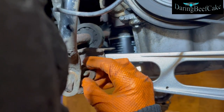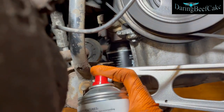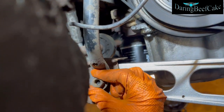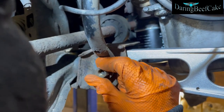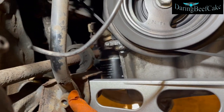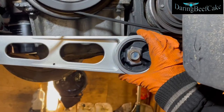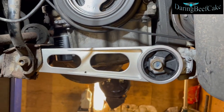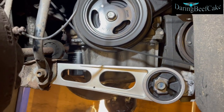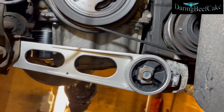We're pretty much done here — just put that back in there, and maybe put a bit of grease on this bolt so it doesn't keep forming corrosion. From here on, just fit that back in there, fit this back, and put your cover back in, and you're pretty much done. You have a nice brand new dog bone mount — or engine mount, lower engine mount. I hope this video helps, don't forget to subscribe and we'll see you on the next video, thank you for watching.